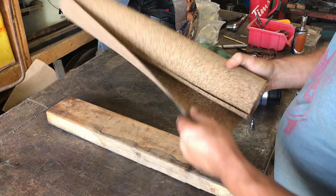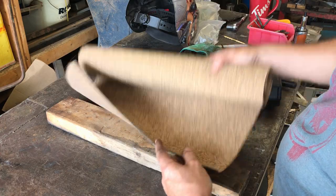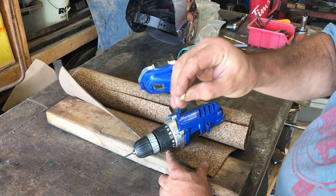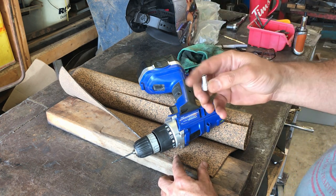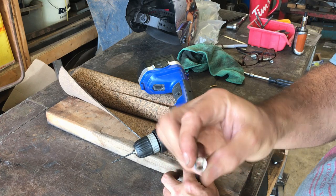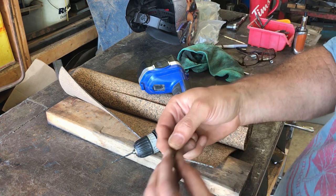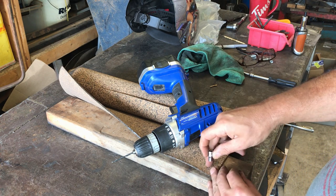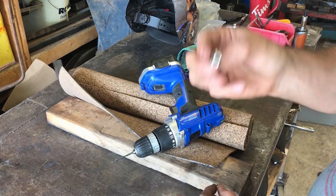Here is my bonkers plan. I'm going to drill holes in this cork gasket material, as many as I like, I've got plenty of it. And the hole I will be choosing will be slightly smaller than the diameter of the adjustment screw, so it's a nice snug fit. For the exterior hole, I'm going to sacrifice one of these little socket hex thingies. Anyway, I'm going to sharpen it down so that it's slightly larger than that, because obviously this one's a bit loose. So once I've got this sharpened, I can locate the hole I've drilled and then punch it out. And I'll try that a few times until I've made sure that hole's centered. And that should be it.